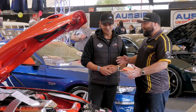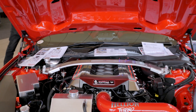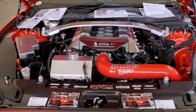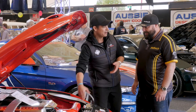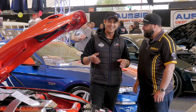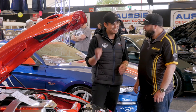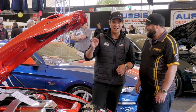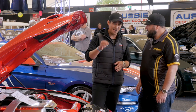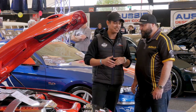And what sort of power does it make? Everything came together so well for this kit. Red car, the number plate is Wicked Pony, the turbo system is Hellion Turbo. Wednesday afternoon sitting on the dyno, gave it a run — low boost of 15 psi on E85. We saw a dyno figure of 666.9 rear hub kilowatts, 894 horsepower, and 1,444 Newton-metres of torque in fourth gear before 6,200 RPM.